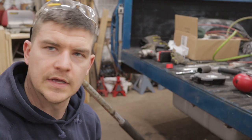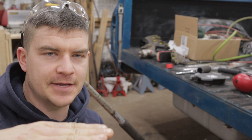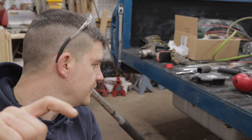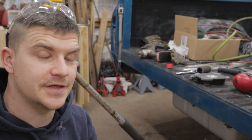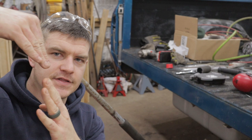In a surprise twist of fate, the tank and the cap line up perfectly, but they're touching. So I'm gonna have to drop the tank back out and shave at least a good inch off the neck of the tank, which I'm surprised I had to do. I was just worried about the hose being too long up in there, but once these are solid mounted, there's not gonna be a lot of movement between the tank and the bed anyway. But I still wanna give enough room so that over time, the vibration and the gas sloshing in the tank isn't gonna rub those two necks.